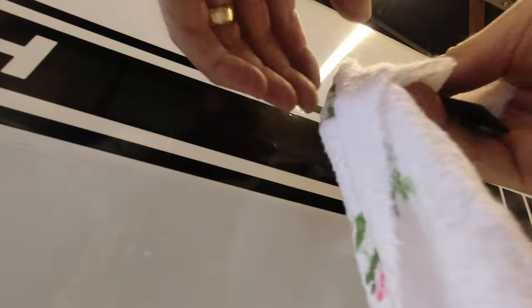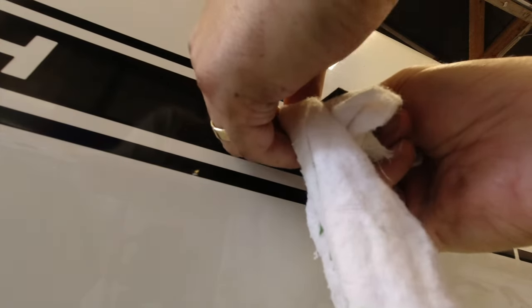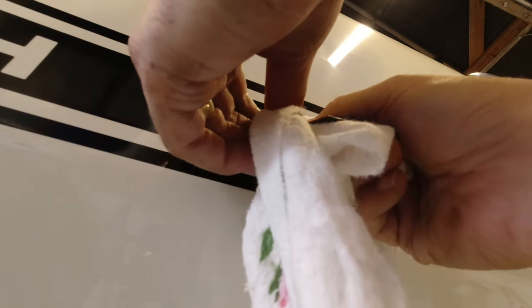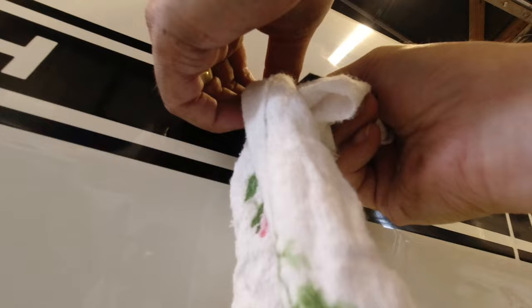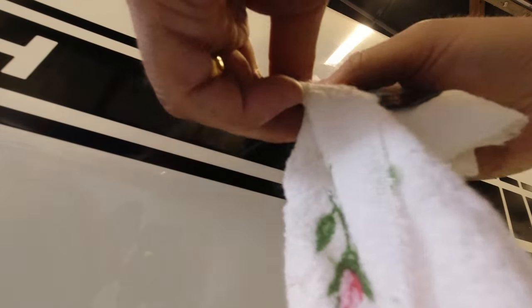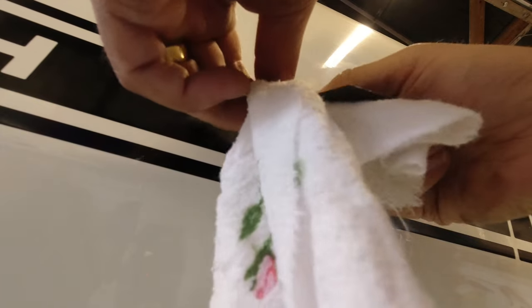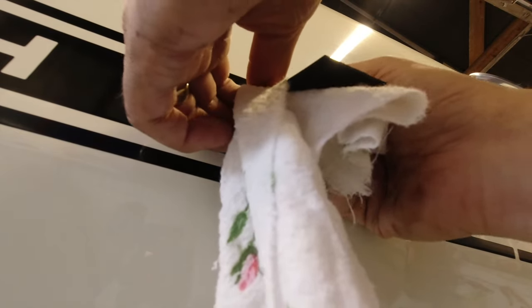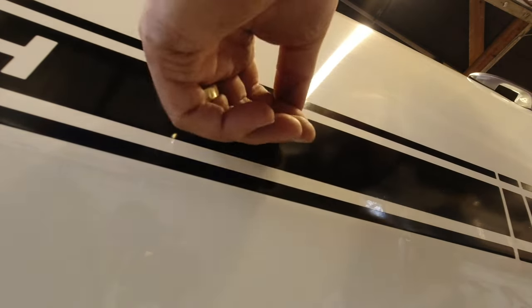There are some advantages to dry as well. When you stick it on, it's stuck, so you don't have the problems with the transfer paper picking the black letters up again. It's a lot quicker, but the wet technique allows for a little bit of maneuvering after you've applied it, and it makes it a lot easier to remove any mistakes, air bubbles, or just reposition something.